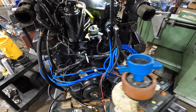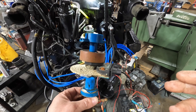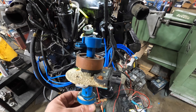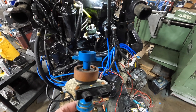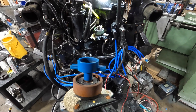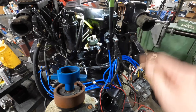Welcome back to our diagnosing series. Today we're going to talk about the GM late model HEI distributor. This distributor was used in cars from 1987 to 1995, and on trucks it was used in some earlier engines like 2.5s. The marine industry started using it around 1989-1990. It was used through the early 2000s and is pretty much extinct since then. We're talking about 87 to 95 fuel-injected Chevy truck engines — Vin K — like the 5.7s, 454s, and 5.0s.